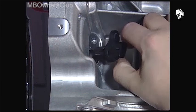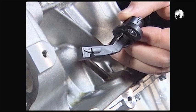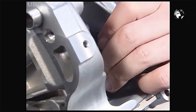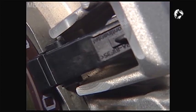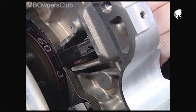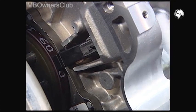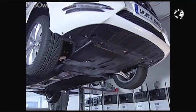The installation of the new sensor requires a little finesse. Plug the sensor into the installation bay and move it lightly along the bend — it needs to go into the guide. Afterwards, gently shake the component and the sensor must not wiggle. Now screw in the whole sensor and reinstall all the heat shields and cover panels.